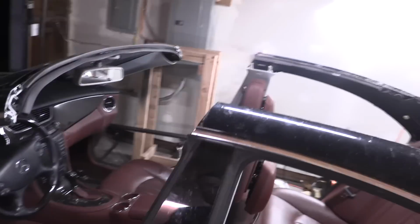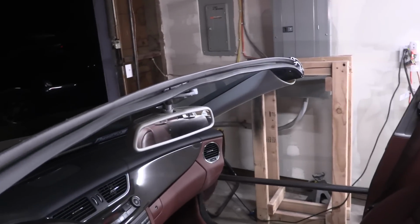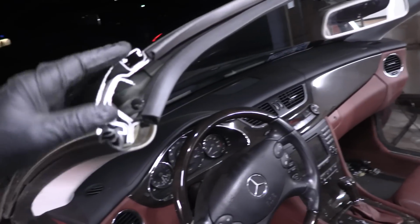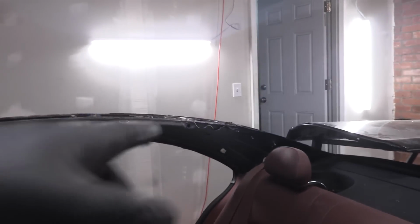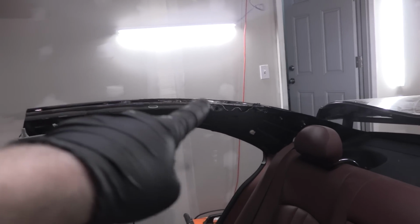That right there looks like some legitimate sized convertible trim. That looks good. Feels nice. Perfect. So I need to paint the raw steel here and here, and I'm gonna come in with a cutoff wheel over there, clean those edges up, and paint all of the inside of this.